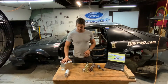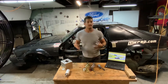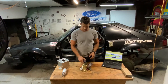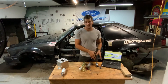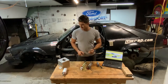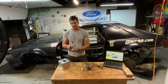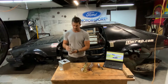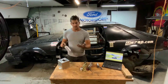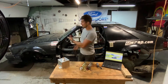Another thing I wanted to go into — a good friend of mine, Dylan, suggested running a surge tank. So how we're going to have our fuel system on this track Fox body: the in-tank pump is going to be in this fuel hanger, and it's going to feed the surge tank. This is a two-liter surge tank I got on eBay — I'll post the link in the description. The surge tank has a different style pump; this is a 044 external pump. This is a no-name pump I probably won't use — I'll go with a reputable name brand.